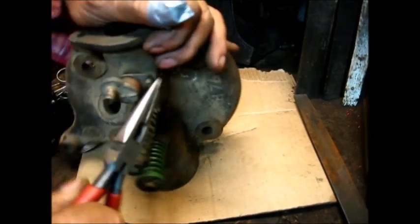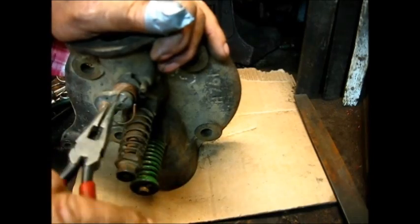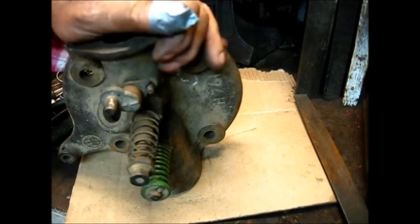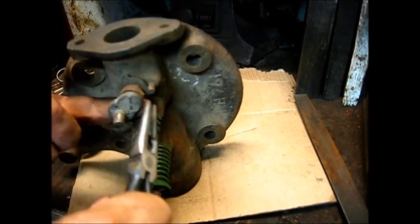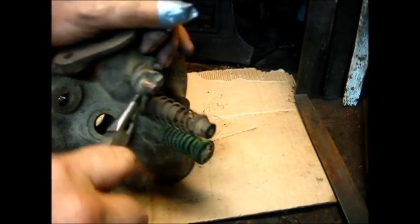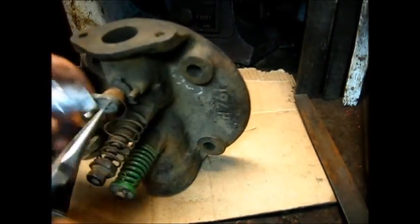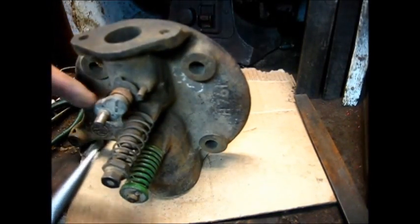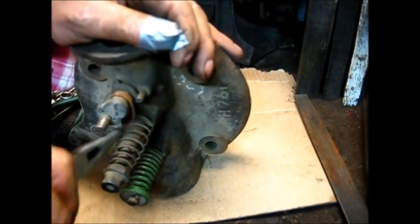I know what you're going to say — it looks pretty good there, why don't you just bend a new loop in it right there? Well, just not good practice. Don't be bending a loop in that thing thinking you're going to be successful at it, because you change the tension of the spring for one thing, and it's rusty, almost rusted away, brittle at best. Now, on the get-go is the best time to replace it. They're available — just make the call, get one on order.